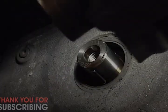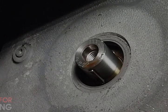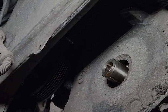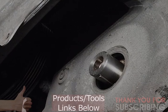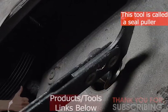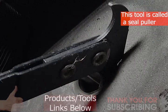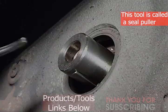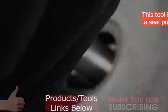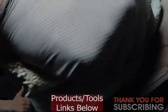Look at this thing. This thing is just some kind of done. Wow. All right. As we can clearly see by the oil, our front seal has given way. No problem. It's easier to go ahead and replace these when they leak just a little bit. It's just like a maintenance thing. If you're going to take the time to pull one out, there it goes. So once that comes out, just want to make sure it's nice and clean.